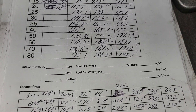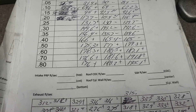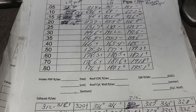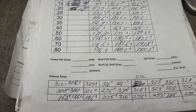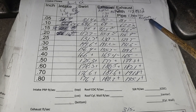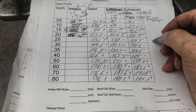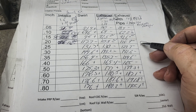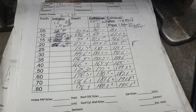I think we're going to move up to my go-to number on the exhaust, which is 86%. I'm stuck between whether I should fix that short side or not — I may have to do an extra flow test. If we keep the short side like this, relatively straight, it's going to lose more and more efficiency because it's coming off the seat with a real hard turn. It would work a lot better if we change that angle — it's something to think about.